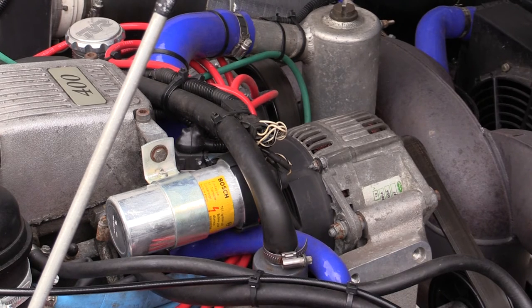My experience with ignition amps is they don't tend to fail slowly — not like the coil. I've got a brand new coil on this because it started to misfire, and it misfired for hundreds of miles until I was able to get somewhere to get a new one. If the ignition amp had failed, that would have been it for the day. They're like a potted component and my experience is they just fail — you don't get much of a warning, you'll pull up somewhere and stop and then it just won't start. Good idea to carry a spare. They're not ridiculously expensive, but try and get an original Lucas one if you can.